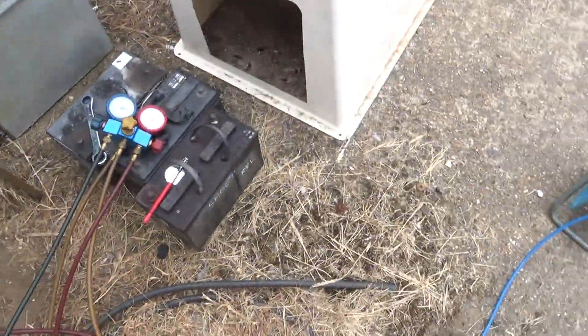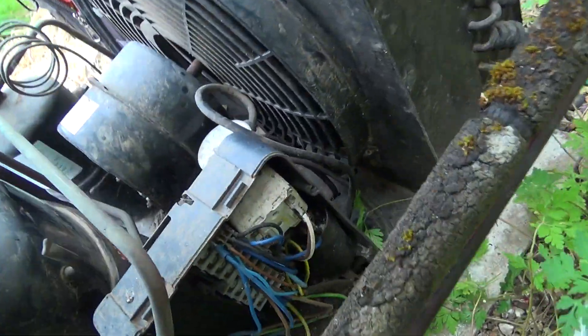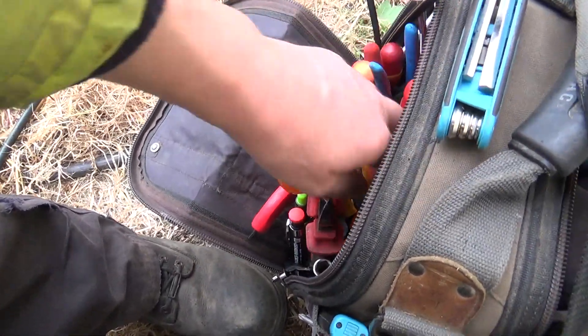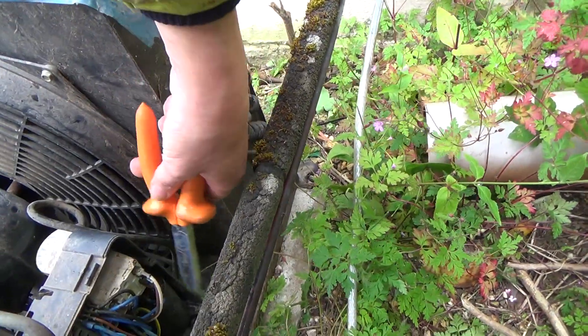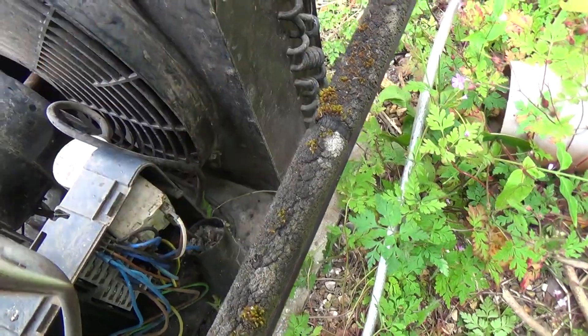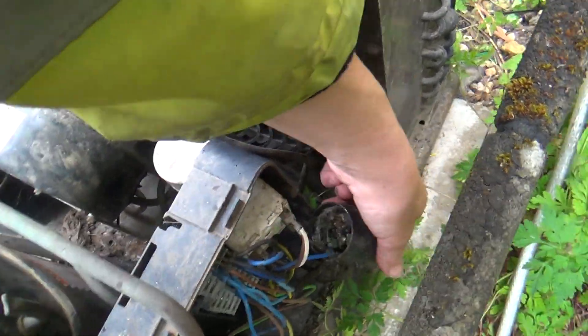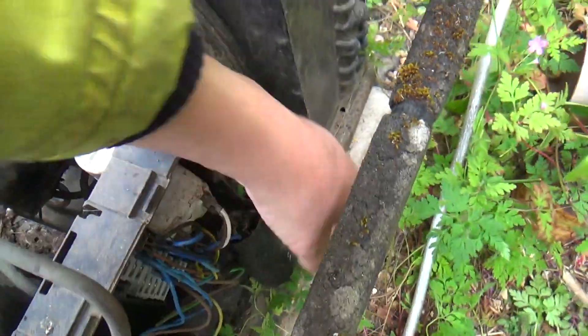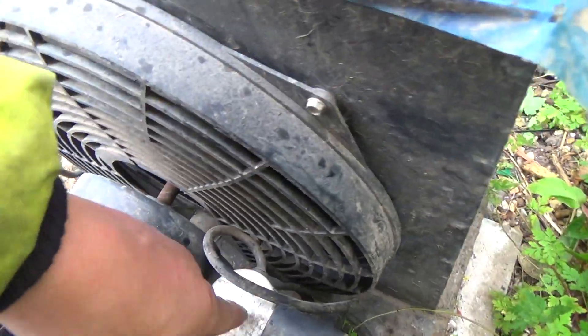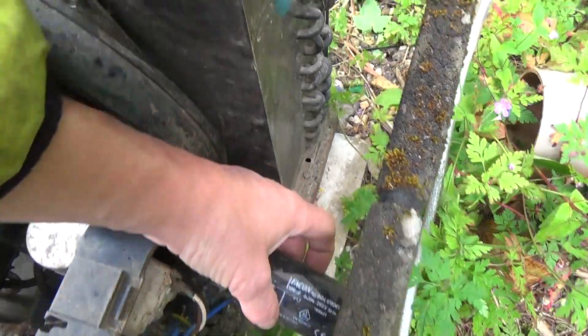Fingers crossed it keeps running. That all looks like it's seen better days - there seems to be a little green crap on the top of that. Start cap - every time I come here it's raining and it keeps stopping the start. Those tiny little raindrops get you soaked. That looks very crusty - oh, that isn't good, that's not good at all. So we'll check that and then we'll check this. That's a 35 run cap and this one is a 100.